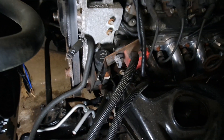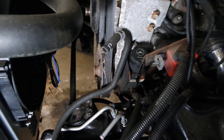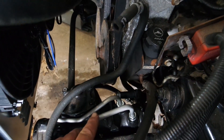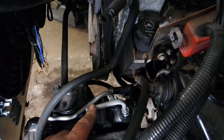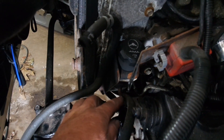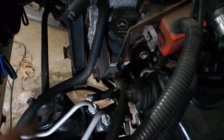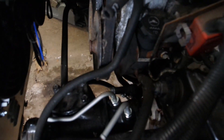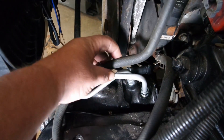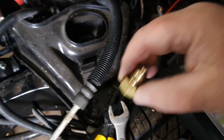You would use your standard power steering line — I'm pretty sure mine's going to work fine, placement should be good, we won't have any issues with that. This is my return line, and this is not the factory return line. The factory return line kind of comes down here and goes around this way, but because I'm using this return setup here on the power steering pump, the other one I've capped off. The way this comes out of here I just didn't really like, so I'm using this one. Here's the hose — I'm actually just gonna cut it right about here, put it on, clamp it down. Let me get that old line off of there and we'll put this on and see how everything fits.